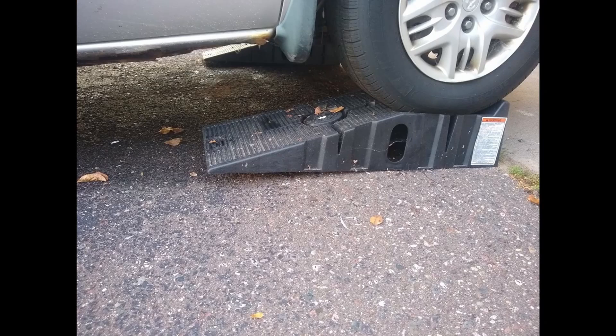That little hill on the passenger side — this isn't something I immediately noticed — but the whole ramp side is not making contact with the ground. This is definitely something to look out for. I suspect a lot of the images I see of these things being cracked have to do with not using level or flat surfaces below them. Be cautious if these things are going to slide forward at all. Make sure that where you set them still allows for a flat surface even if they scoot forward a couple of inches.